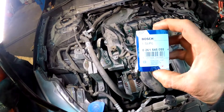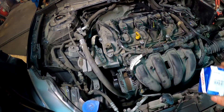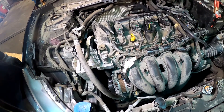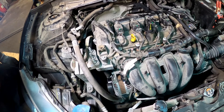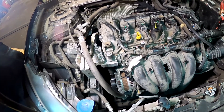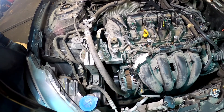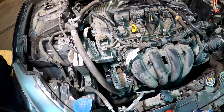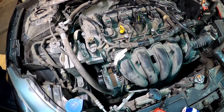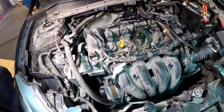So yeah, this is the fix — put one of these pressure sensors; it's a GM car sensor. If you have any issues with a Mazda 1.5 engine, which comes in a 2016 Scion, 2017 and 2018 Toyota Yaris — they also have the same 1.5 engine — the dealer does not sell this pressure sensor by itself. So if you buy one of these Bosch sensors, it will definitely work. I already put it on, turned it on right away, took it for a spin, everything's reading good. If you guys want to save some money, just replace it with one of these sensors and you're good to go. Thanks for watching The Art of Automotive — if you like this video put thumbs up and don't forget to subscribe.